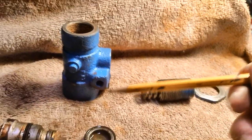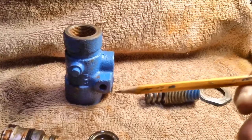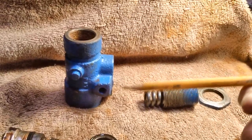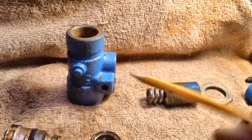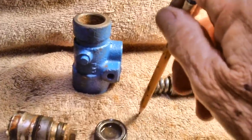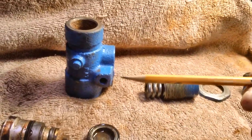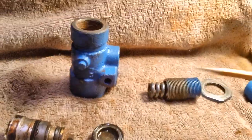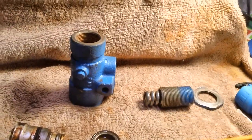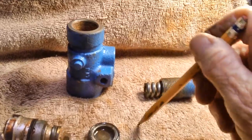That prevents all 4 brakes from grabbing at the same time. If you do that, the rear brakes will lock up on you, and then you go into a fishtail, all kinds of weird stuff happens. So the front brakes have to grab first. All of this happens within a matter of 1 or 2 seconds, we're not talking about something that takes place over a minute and a half. But when you slam on your brakes, or hit your brakes at high speed, front brakes grab.